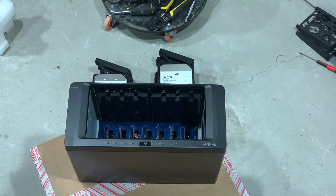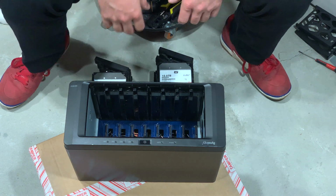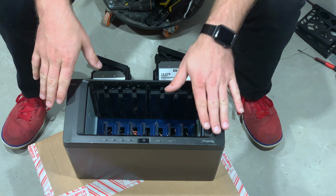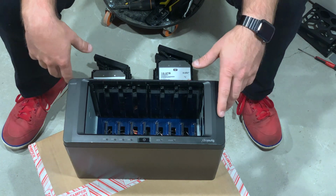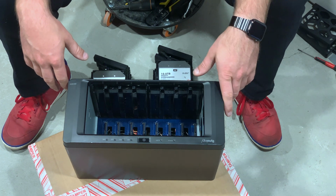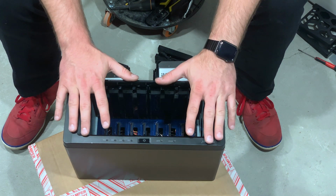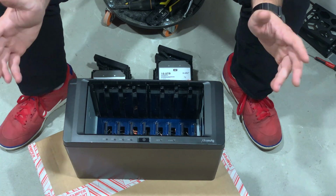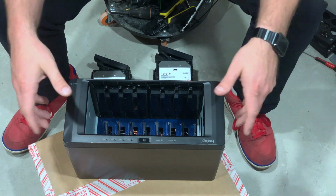All right, so now we have the 2 8GB sticks installed. And I gotta say, after like 2.5 years of owning the existing machine, I've never seen the RAM usage be above 6 gigs. So the 16 gigs is overkill unless you're gonna be doing any virtualization. That does support virtualization, but I'm not using that, so it's overkill. But you know, the biggest thing hampering me is I/O, because I'm using 5400 RPM NAS hard drives.